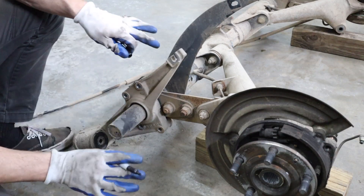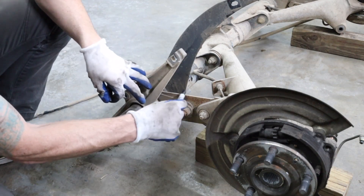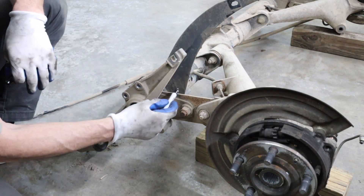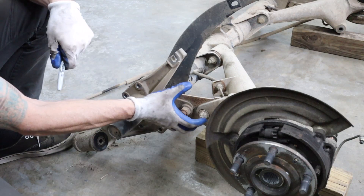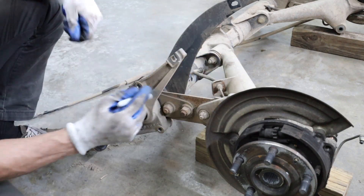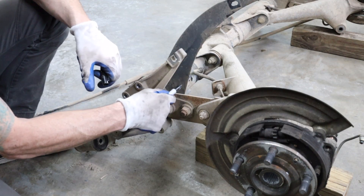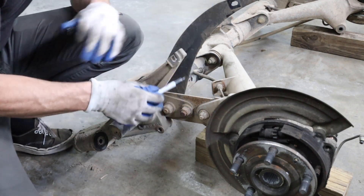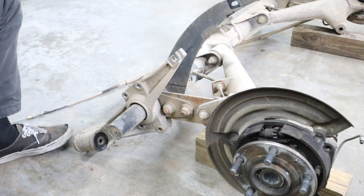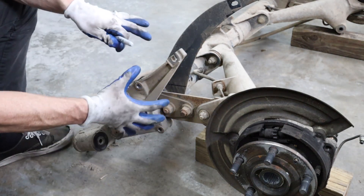What I'm going to do now is locate my spring plate in its stock position on the torsion bar against that mount. If you've static lowered these cars or even lowered a VW Beetle before, you'll know what this is doing. Basically, you can pull your spring plate off and re-index it on the splines of the torsion rod to lower the car — or re-index up higher. You want to mark where it is stock so when you pull it off you know you're going back in one or two splines lowering it.